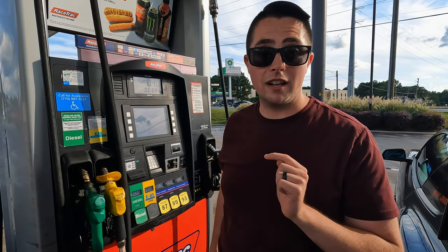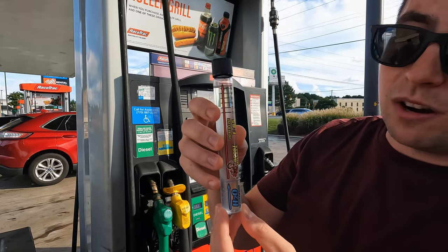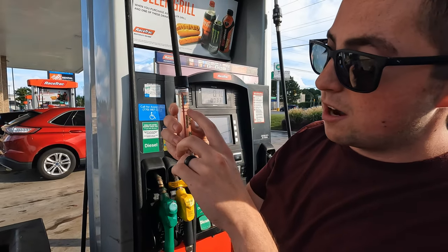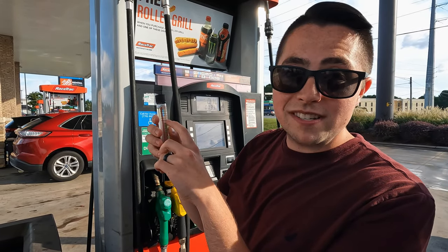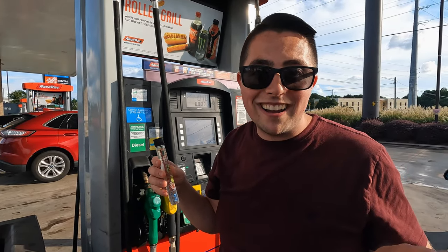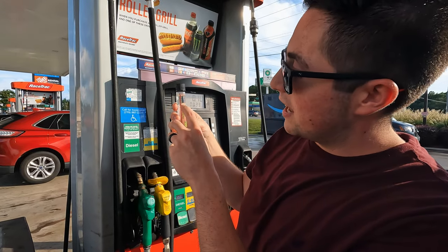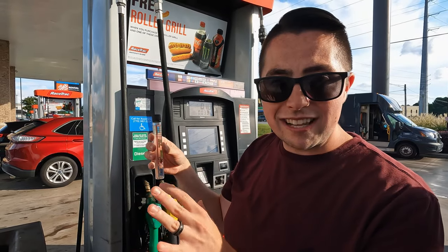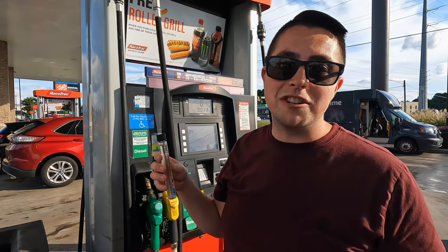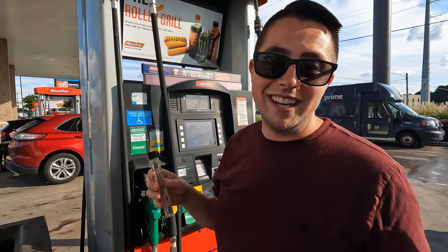It looks like our test is about ready. It's been about three to four minutes and you can see the test is starting to show up — do you see that separation? That's the ethanol separating from the rest of the mixture. We're sitting right at 75%. This is exactly the same as what it was last week when I did this test — I actually did this whole video last week but the audio was corrupted, so I'm doing it again. Looks like we're gonna be sitting around 75%, so I'll let it sit a few moments longer, then take that data and pop it in the calculator to see how much E75 and 93 octane we need to get E30.